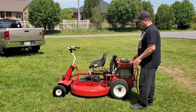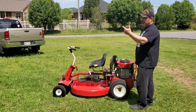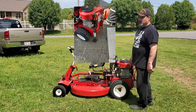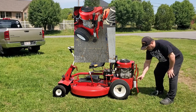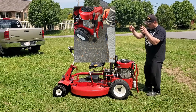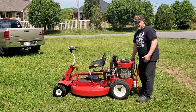I did all that. Did a test crank last night, and everything went good. My wife was in the garage getting something, and I had come out after we called the doctor, and the garage doors were up, which is rare for her, because this thing was pouring fuel. Pouring fuel out of this one. This header wrap was wet, so I yanked the plugs out. Fuel just ran out. I didn't have the fuel cut off, but this goes up to a fuel pump, so it has some kind of siphoning effect going on.